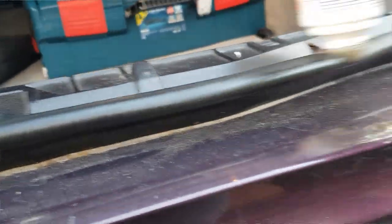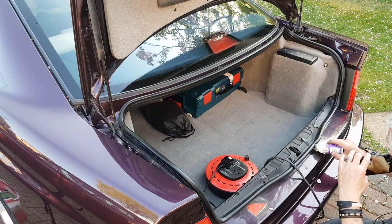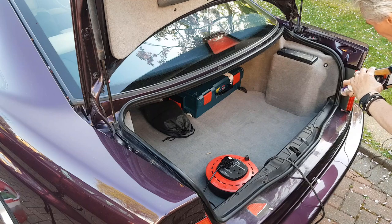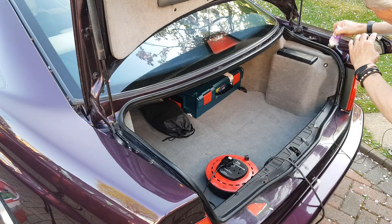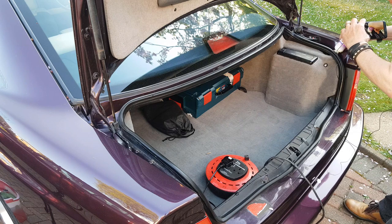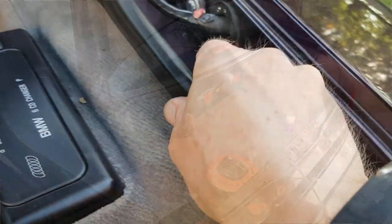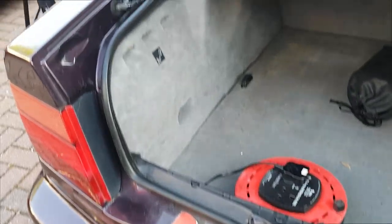That looks fine. If the seal was dirty to start with then we'd clean that with a paintbrush - maybe I should have done the edge of the boot, it does look a bit secondhand there. Pump a bit more of the stuff out. The handy thing with the sponge is it does go right down the side of it and the whole sponge is saturated so it does go around the back. Make absolutely sure it does go around the back and right down the side of it. Boot seal done - well, that's not going to get stuck. That's much better.